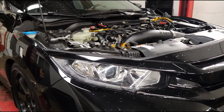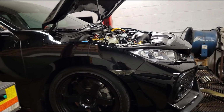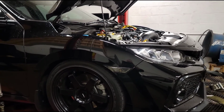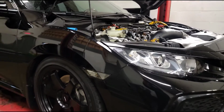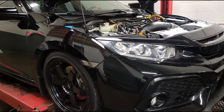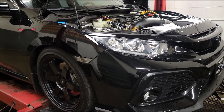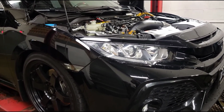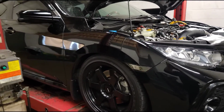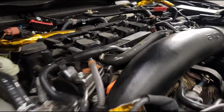And then ultimately, we got to go get some E85, put the E85 in, of course, and make sure that not only that the gauge, he's got a gauge, and inside ktuner, I can actually see what the ethanol content is. Make sure that it is changing, and make sure it's changing everything correctly on the back half of the actual program. And that's where I think there's a lot of, I don't want to say misinformation, I think there's a lot of confusion. Let's just leave it at that. So that's what I'm going to do here, and I will be back shortly.